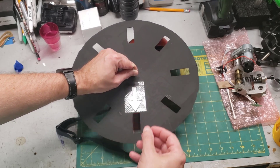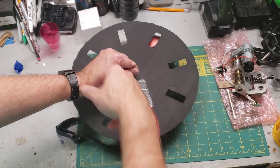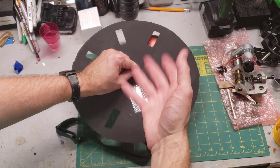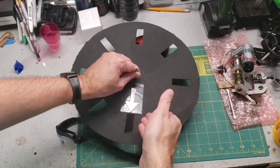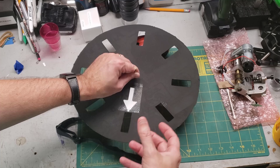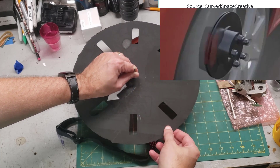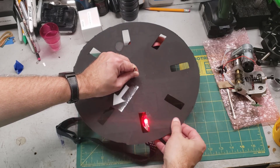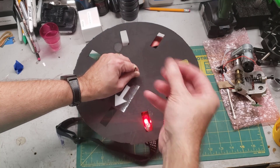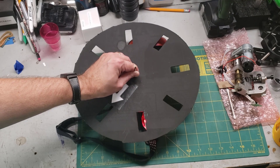This is super important for a lot of systems. For example, anti-lock brakes — which may not use light systems, but might use incremental distributions of magnetic fields or magnetic pulses. If they notice that the pulse has paused, that means the wheel is locked up and an unsafe condition has happened — the wheel is probably skidding. They would then release the brakes momentarily to make sure the brakes are not locked up. These encoders play a very important role in our everyday lives, especially with safety. If you're driving a car with anti-lock brakes, you are working with some kind of incremental encoder.